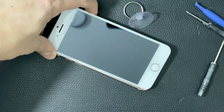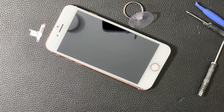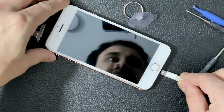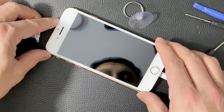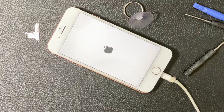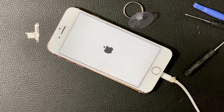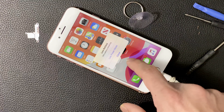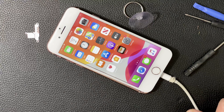I'm holding the power button. Sometimes you might have to connect it to a direct power source if it doesn't turn on, since we did put it in DFU mode — that way it should start. Right now we see the Apple logo come up, and after the Apple logo this time it should take us to the home screen and not do the boot loop we saw before. As you can see, it did take us to the home screen and we're not in that constant boot loop.